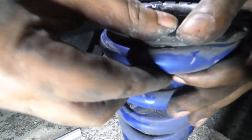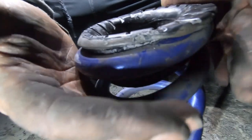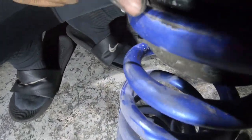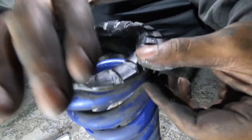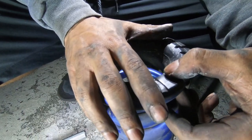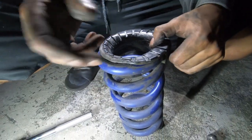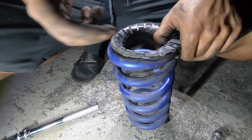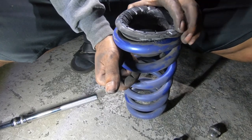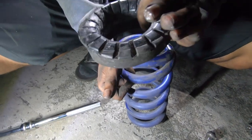So if you look, this was mushed in - it's not supposed to look like this at all. It wasn't sitting there correctly. It's supposed to be more over that way - right now it's offset. See how this one right here was touching the metal, as you can see it's engraved. This spring got installed maybe three or four years ago before I had tools and before we even thought about doing YouTube. I didn't have too many places I could go to do this myself. That's what happens when the first person who installed this did it incorrectly, and that's why we're fixing it and stopping the car from squeaking.